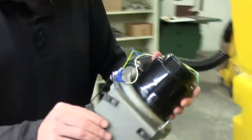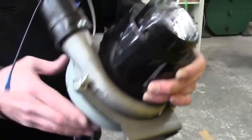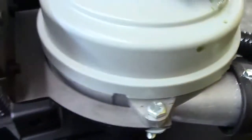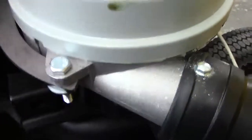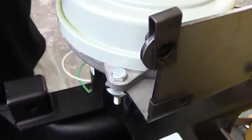We've gotten the motor out. If you're replacing the entire assembly, it'll come to you just like this — hose is already on it, and remember the cuff unscrews, it's not glued. But if you're just getting the vac motor only, you'll need to remove the self-tapper here, and there's a small self-tapper here and another one on this side. You'll need to move your hoses over to your new motor, remove these bolts, and move your bracket from this motor to your new motor.